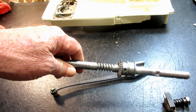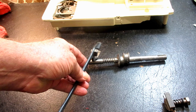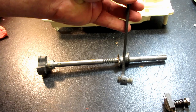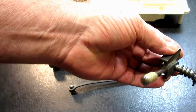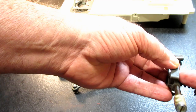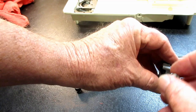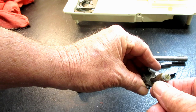The take-up lever and needle bar system would be connected in here. This piece is called the forked feed connection, and it runs from the horizontal arm down to some shafts in the bottom that make the feed dog move. This is the feed regulator, right here. This is the bolt that bolts through the machine below the hand wheel to hold the regulator. And this is what people call the stitch length control.